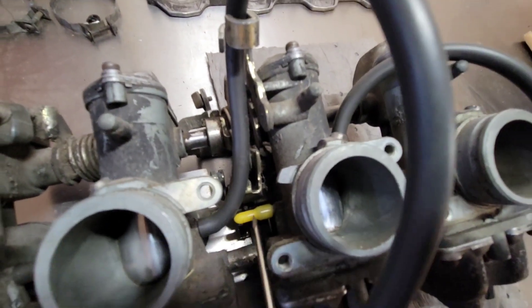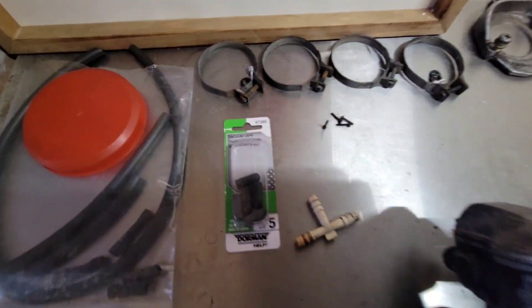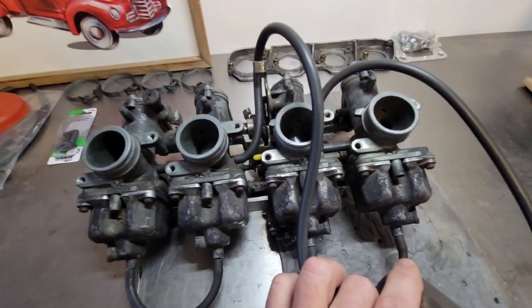The line here that would normally be going across to these two — I have it blocked off with a vacuum plug. I actually just got some nice rubber vacuum plugs to plug that off. It's probably going to get glued on there because I don't ever want it to come off under pitot pressure — there will be pressure in here. Whatever pressure comes out of the turbo, the pitot will see the most of it. The pitot pressure will always remain higher than everything else, so those tubes have to be good. They can't come off under boost, they can't wiggle loose. A little bit of glue or epoxy when you slide them on locks them on there for life. Put a zip tie or a clamp on them so they can't expand under boost and slide off.